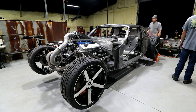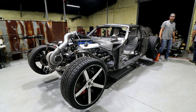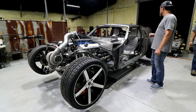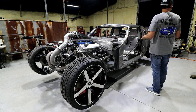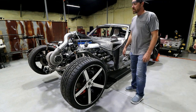Also, does that have some sort of self-tuning? It does. Yeah. Once I get to where I can get out and kick around the street, it gets self-tuned, kind of. What it does is it records data, and then it'll do some correction, but it'll come back and look at the data log and tell you, all right, it's way off here. Yeah. This is where it needs to be. That is cool.